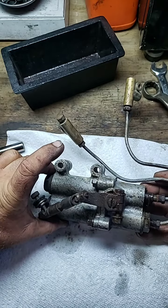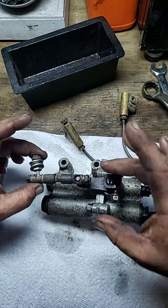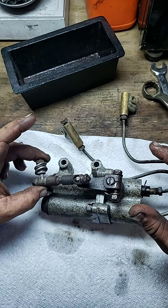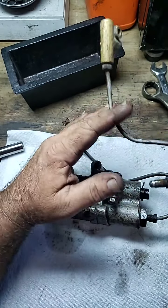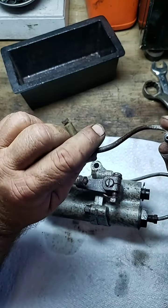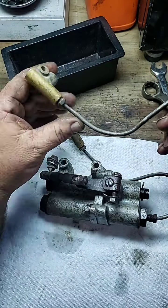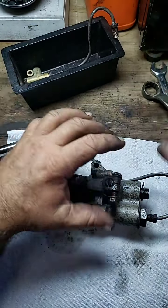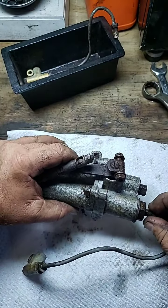What we have here is a control valve — this is the height controller. There are two of them on each Rolls-Royce, one on each trailing arm. This is the measurement device that goes up and down to raise and lower the automobile accordingly. We're going to start peeling it apart using tubing wrenches. This one is seized up, so we'll have to address that. You can see how it flared itself over the last 50 years. These are the valves that go to the rest of the vehicle.